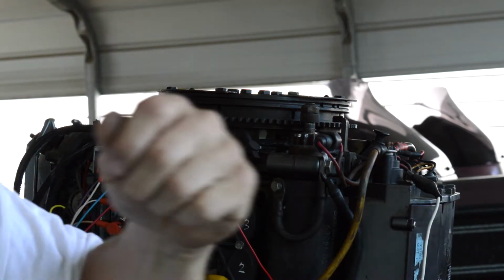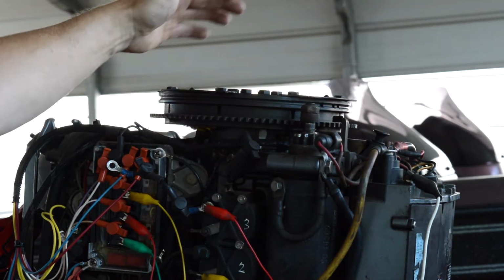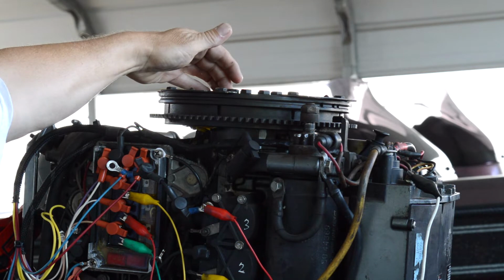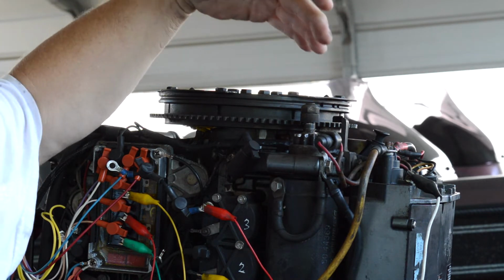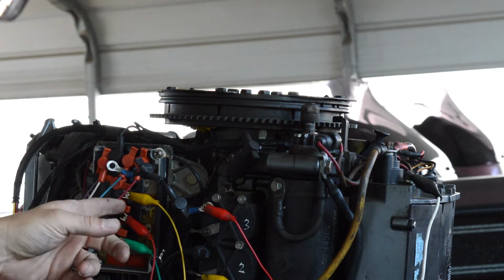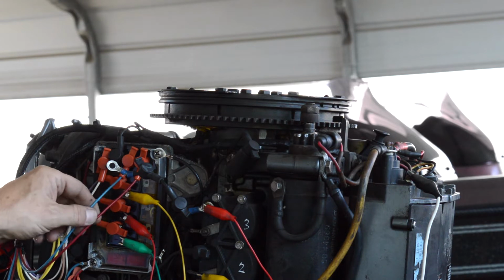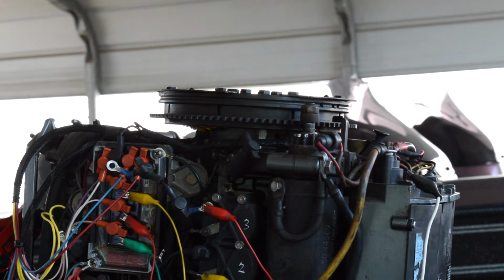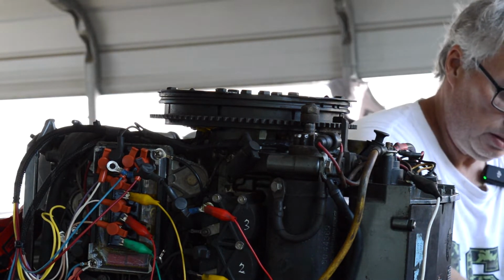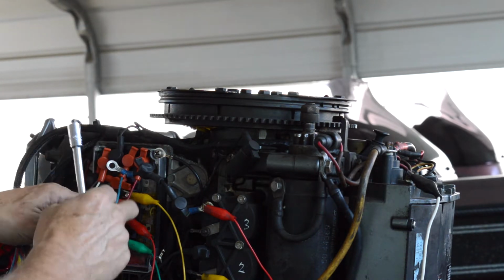Now, obviously, your trigger arm where you go back and forth is going to change the timing of it. But right now, my number 1 was triggering way over here. So why is that? Because at idle, it should be triggering over here. So we're 180 degrees out. That led me to believe that maybe our purple wire, our violet wire, was really at the mark that should be our number 1. So we're going to try to figure this out and see what we come up with. And I'll put my camera up, maybe up here where you guys can see it.